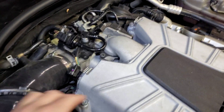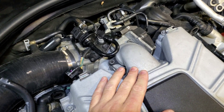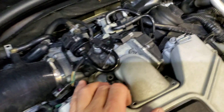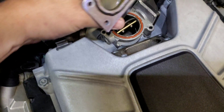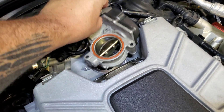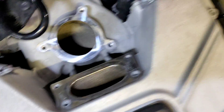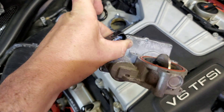One other thing: wait for this to cool down before you work on this. First, you'll get a false multimeter reading if the engine's too hot, so you want it nice and cool. Second, this stuff is really hot and you're going to have your hands in here. But we've got all the screws out, so I'm going to go ahead and start pulling this out. This just pulls off — we can set that off to the side. It's got the little spacer attached to it, and then this just lifts off. You can see there are some gaskets — they're in good shape, we don't need to replace those. There's that little mini butterfly valve for the bypass valve.